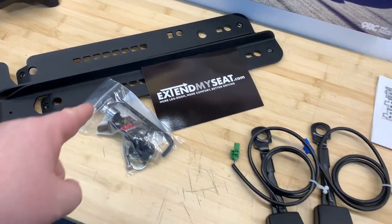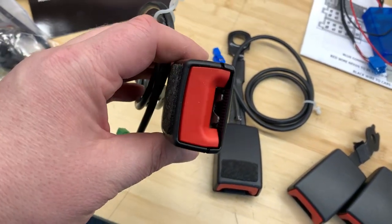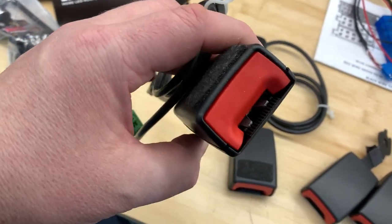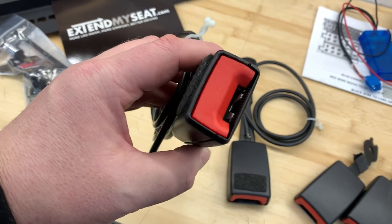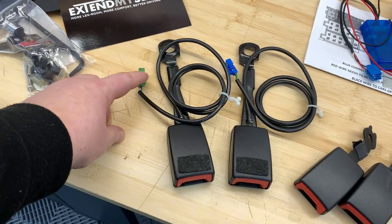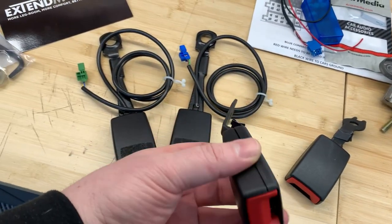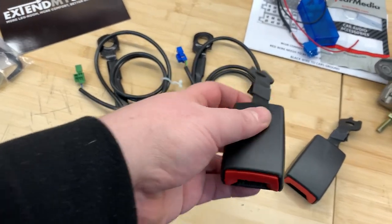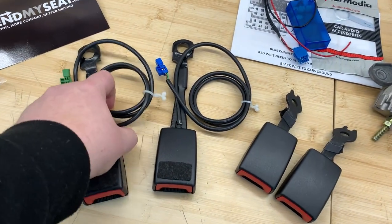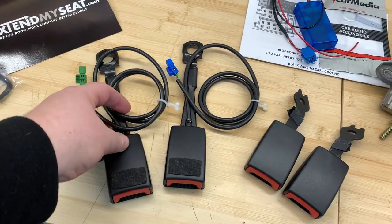That is like Christmas. And then here, I'm changing out the old and worn seatbelt receptacles, which are now orange or even just white. They look really old, you know, 20 years old like the car is now, and cracked. So I've got the seatbelt receptacles which need to go into the wiring harness there for the front seats. And then the rear seats, they're just simple bolt-ins. These are really easy to replace. I've done these before, or at least I've taken them out and put them back in before. These also look relatively straightforward. Looks like one bolt, and then you just gotta find the wiring harness.